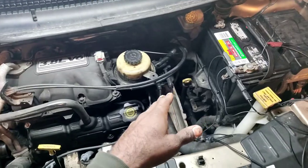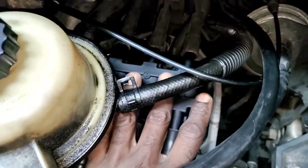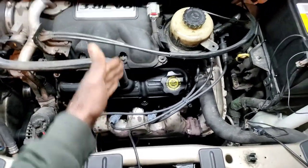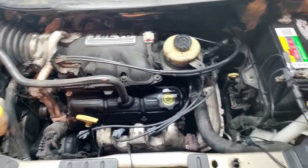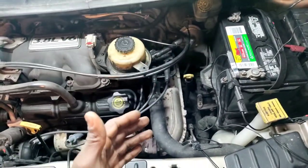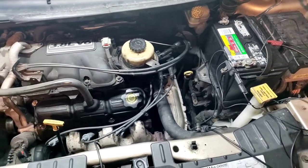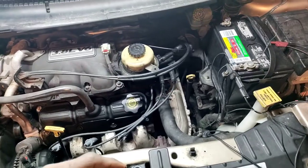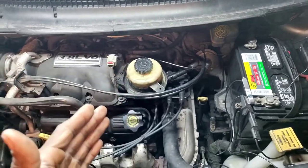This has a waste spark setup. If you divide these coils up you'd get more of a waste spark setup. Some vehicles like a 2.4 Chrysler engine will have a coil with a wire that goes to a different cylinder. What this does is once it fires, it fires multiple banks that are on opposing ignition events, if that makes sense.